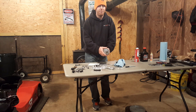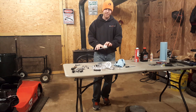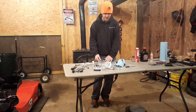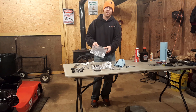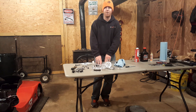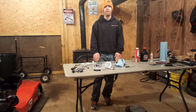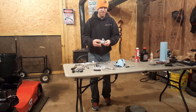The Mod 2 cam is a budget cam but it comes with most of the kits and it's good for the money. I've got a couple different thickness head gaskets to try out. When I take the head off I'm going to look at our tolerances and clay the top of the pistons to see how much I can get away with. The kit comes with a gasket kit which includes a thin metal head gasket — about ten thousandths, really thin. We're going to bump the compression up as much as we can by going with the smallest head gasket we can get away with. We're putting in 18-pound valve springs, and with that cam I think it's really going to wake up the bottom to mid range.